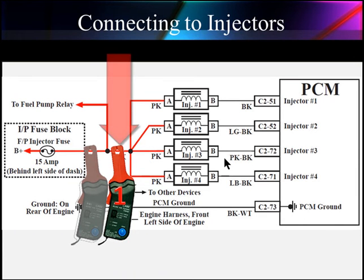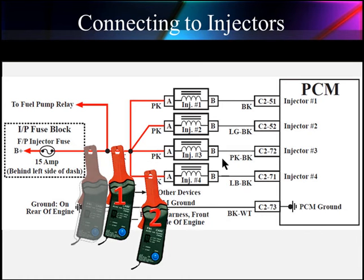I've got two amp probes here — number one on the right and the ghost on the left. Be careful of where you're hooking into the wiring. Probe number one is hooked so it only sees current flow going to the injectors. The ghost on the left, if I hook around that wire, I'll also read whatever current is going to the fuel pump relay. If I'm on the left with the ghost, I'm reading multiple devices — not just the injectors, but any other amperage being drawn through that extra branch. Getting between two splices would require taking the wiring harness apart.